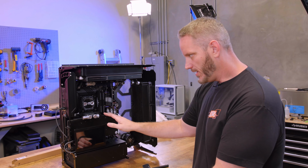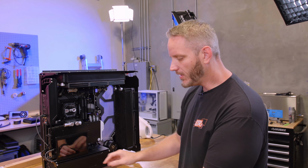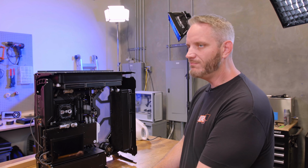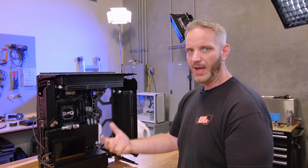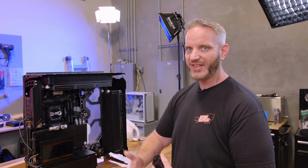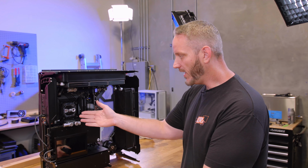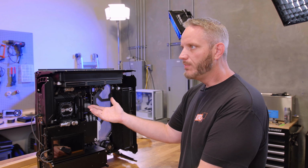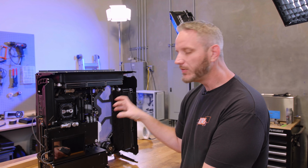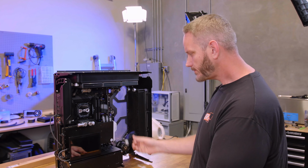It does not matter if I go CPU or GPU first. It does not matter. So for the love of God, please stop arguing that point. This is not a car. We do not have massive deltas in temperatures between an engine block that's creating thousands of degrees inside the cylinder trying to be cooled by liquid. We are talking about something that has only, what, maybe 30, 40 C difference between the hottest component and the fluid temperature itself. Doesn't matter on the order.